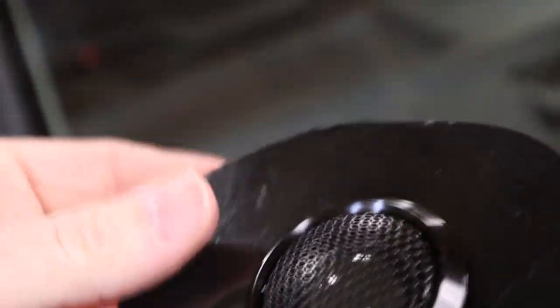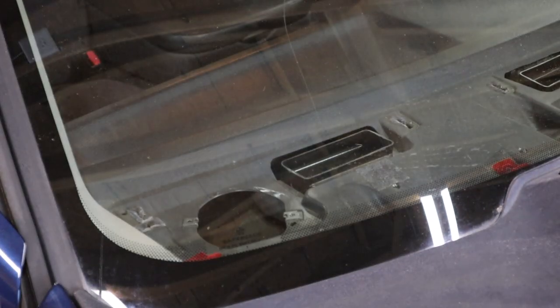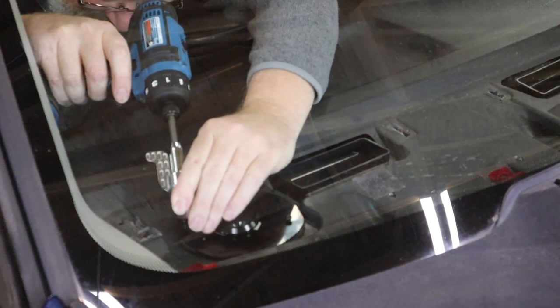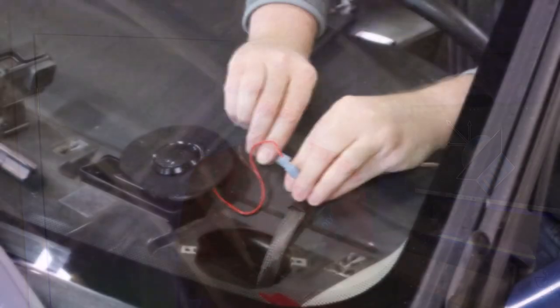In this shot you can see some gasket material that I stuck to the back of the tweeter mount along with the double-sided tape holding the tweeter in place. Now it's just a matter of connecting to the existing wiring and screwing them all down. I pop the doors back on off camera and now I'm ready to see how it sounds. This track is called Digifunk — I've been playing it as background music throughout this video so you can rewind and compare the sound.